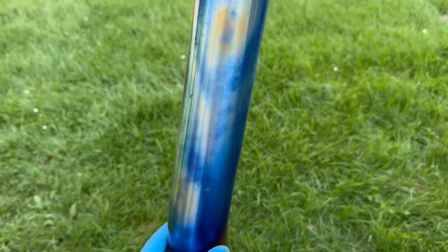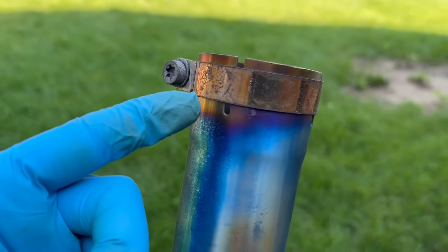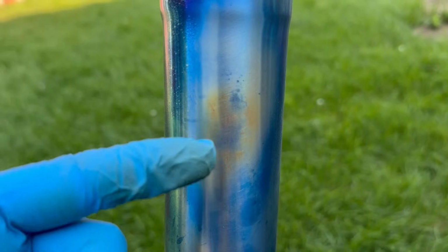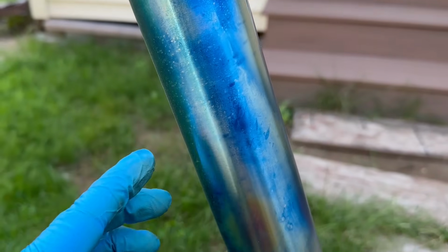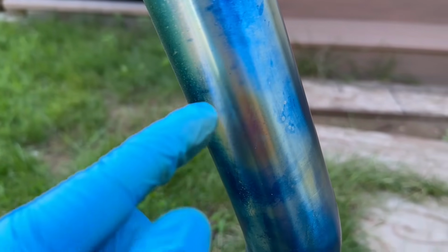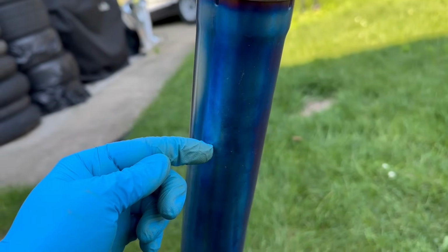It is still pretty hot, but the white splotches on this are where I got too hot on that titanium. The heat colors of titanium are silver, then gold, then purple, then blue, and then this white. So if you hold the flame in an area for too long, in about a couple seconds, it will turn into this white splotch. Another mistake is I should have cleaned this titanium before I heated it up. All the impurities in the titanium are coming through when you heat it up.